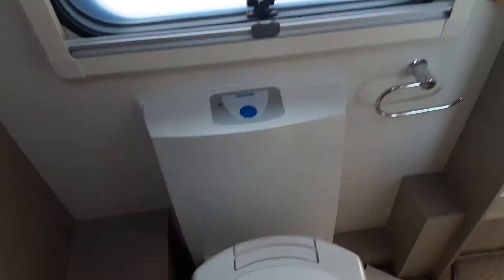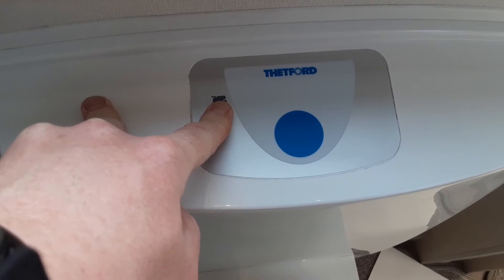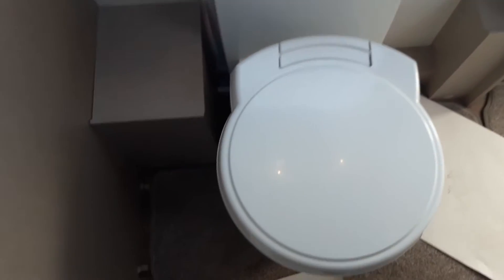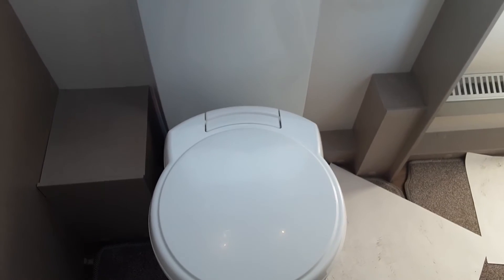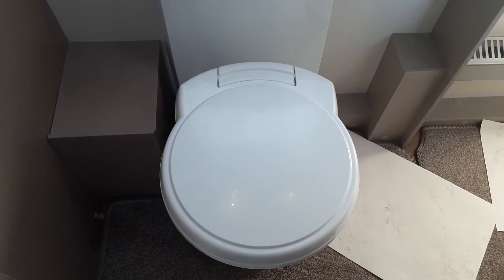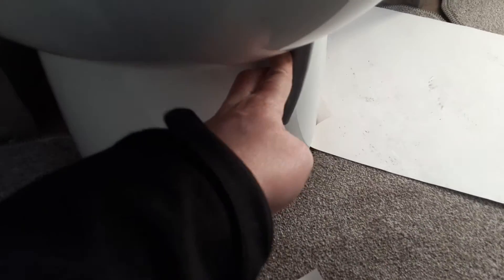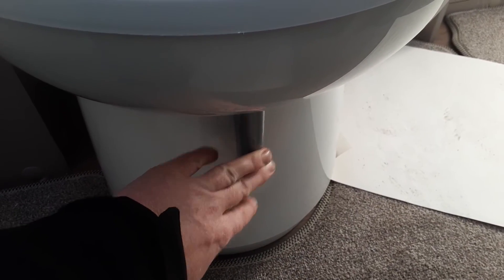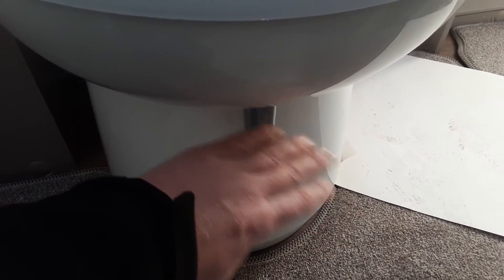Going into the bathroom — there is an electric flush on the toilet. A red indicator light will let you know when the toilet waste cassette is completely full. The toilet seat turns for your convenience, but when removing the toilet cassette from underneath the van you need to make sure the seat is back in the central position, as a turned seat will lock the cassette in place so it cannot be removed while in use. The grey handle below the toilet also needs to be in the closed position — if it's open the cassette cannot be removed. We always recommend keeping it in the closed position when not using the toilet.